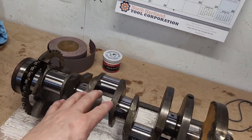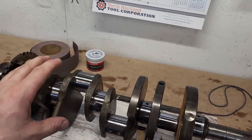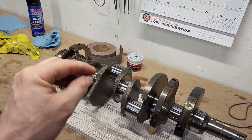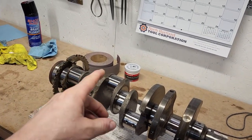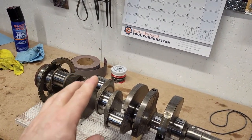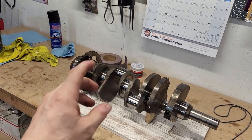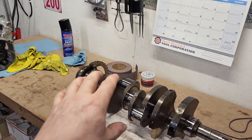If the crank really needs some nicks or scoring taken out of it, we're not looking to remachine anything — we're just trying to polish. By definition of what we're doing here, we are going to be removing minuscule amounts of material. I don't believe that's enough to affect oil clearances. But if you really need to get heavy after one of the journals with some nicks, the emery cloth should take care of you. Anything more than that, I would suggest getting the crank cut. We're looking at just spiffing up cranks that are in generally good condition, or maybe have real minor imperfections — maybe a little bit of junk went through a bearing or something.